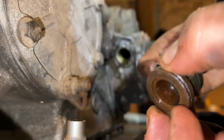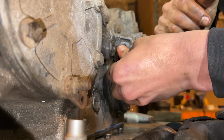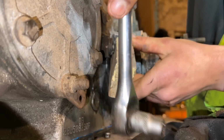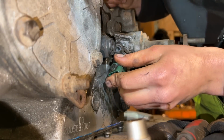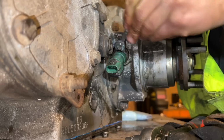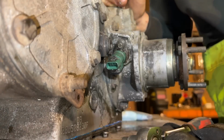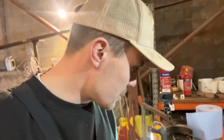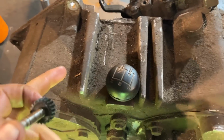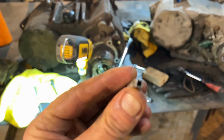How does this go? Like that. Yeah. Are these gears going to mesh again? Yeah, seems alright. Sensor goes on. They obviously changed their design at some point, but I've changed it back for them. There's obviously slight variations in these two transfer boxes and they're not the same. You can see that straight away because these vein-shaped things here, 1, 2, 3, none of them on this transfer box. This cog is slightly different, the sensor hole is slightly different.